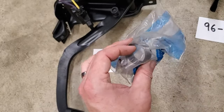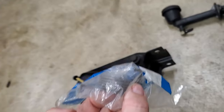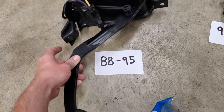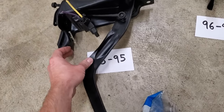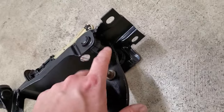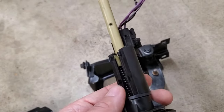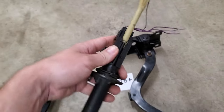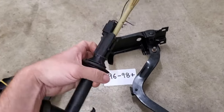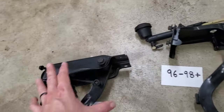This actually goes through and it twists to lock in. As soon as you press the clutch, that spring flings the clutch pedal back into the resting position it needs to be in. Whereas on the newer version, you don't have an external spring on this sleeve — it's actually built into the clutch master cylinder. You can see one spring right there and another one right there. There are two built in, and it makes more sense once it's actually locked into place. So not only is the spring situation different, but the clutch bushing situation is different as well.